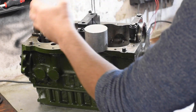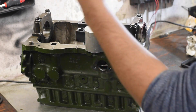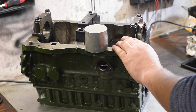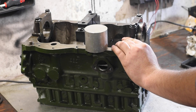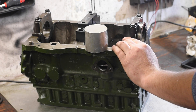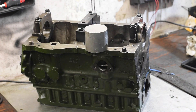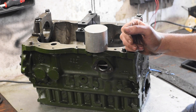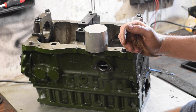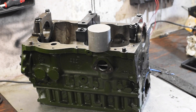What these bushings are made out of is not critical. Ideally we would make these out of phosphor bronze, which is a very low-wearing, high-lubricity material. But over the years I've done a lot of engine work and I know that one of the good material combinations in modern engines is aluminium cylinder heads and steel camshafts. Once the clearances are tight between the aluminium and the steel you can get very good wear resistance, as long as you have good lubrication. This is a process I'll probably only do once or twice a year, so I'm more than happy that a piece of H30 aluminium will be a good bearing material for these engine blocks.